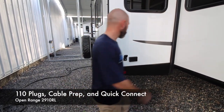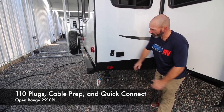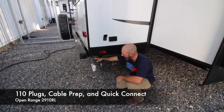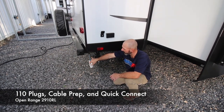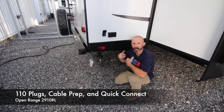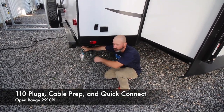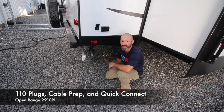On the back side of the camper you're going to have two 110 plugs and a cable outlet, so if you wanted to set up a TV on the back side you plug in here. Down here at the bottom you have a quick connect: if you want to bring a burner and cook outside, get the right connector, hook it up to your burner, plug it in here and you can use the bottles on the camper. Notice there's a valve on here — once you turn that valve on it won't let you undo the line until you turn it off, so you know for sure you don't have any gas running through the lines.